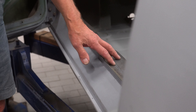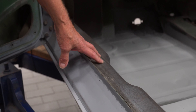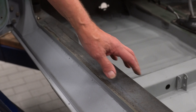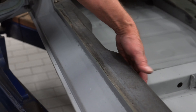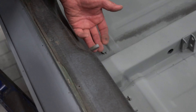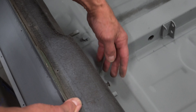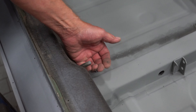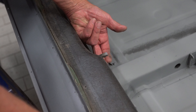This floor pan tar was only on six-cylinders. The engine noise and fan noise of the six-cylinder coming up through the rocker was pretty deafening. So Porsche knew, when they had these cars brought over from Volkswagen, that they had to put extra sound deadening in. This piece, as you can see, is factory cut and factory installed. You can add this to your four-cylinder — we do make the kit — but it's not really necessary for the four-cylinder. The emergency brake for the early models was what we call a breakaway handle. The top part rested here and then it pivoted right here. In later models, it was so inconvenient that people would leave the brake on, thinking it was off, drive away, and burn up the brakes, so they discontinued this. A pure sign of an early car is this peg right here for the handle to rest upon.